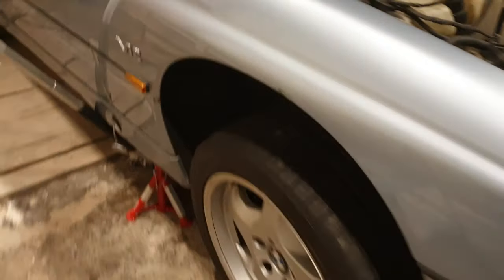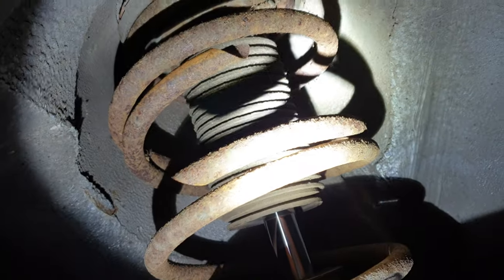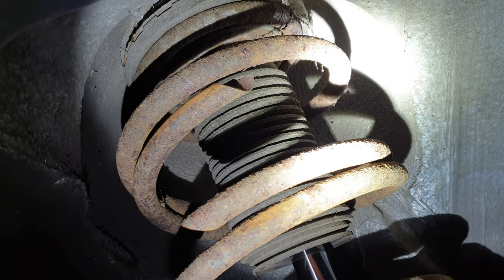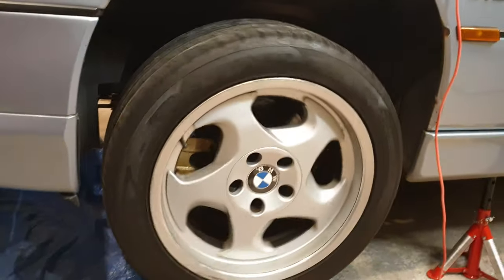I have the car in the air for the first time. It's only up as far as the jack stand allows, but I just spotted this — I've only driven this car about 3 miles but yeah, broken spring here on the right-hand side, absolutely completely sheared off. The caliper is catching a bit on the right side, and then on the left side pretty much the same story with that wheel, but not too bad — and the spring is actually fully intact there.